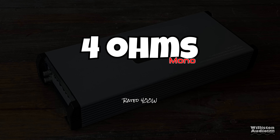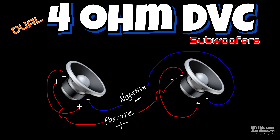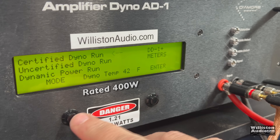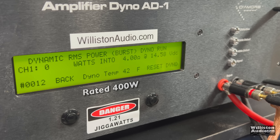This here's my favorite part. First test is going to be 4 ohms — it's rated 400 watts. We have some examples here of how you get 4 ohms: a single 2 ohm dual voice coil subwoofer wired in series, or two 4 ohm dual voice coil subwoofers wired in series parallel configuration. The certified test up to 1% distortion shows the amp stops at 180 and then jumps to 357, so it did not count cleanly. Going uncertified up to the clipping point, we get 373 watts at 14.37 volts — statistically about 10% off the 400-watt rating. Dynamically, we also get 373 at 14.46 volts.